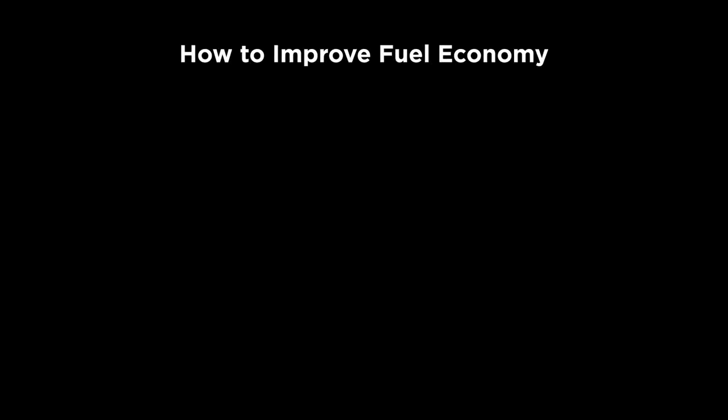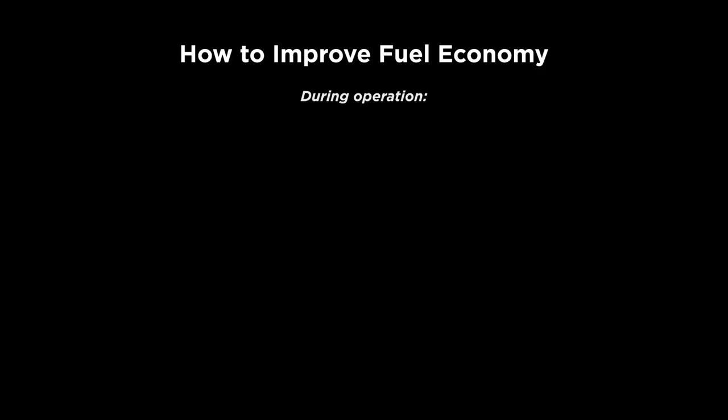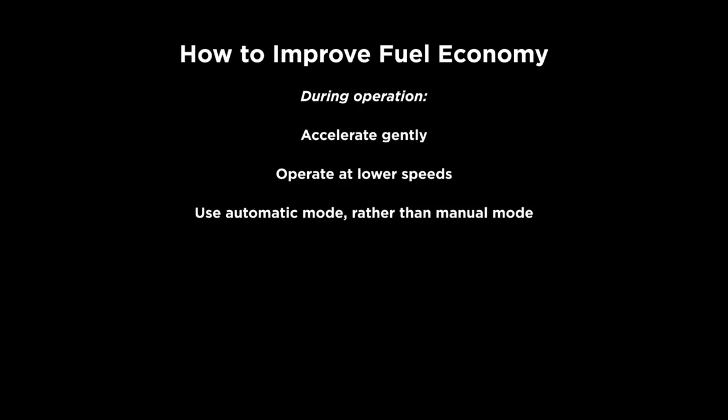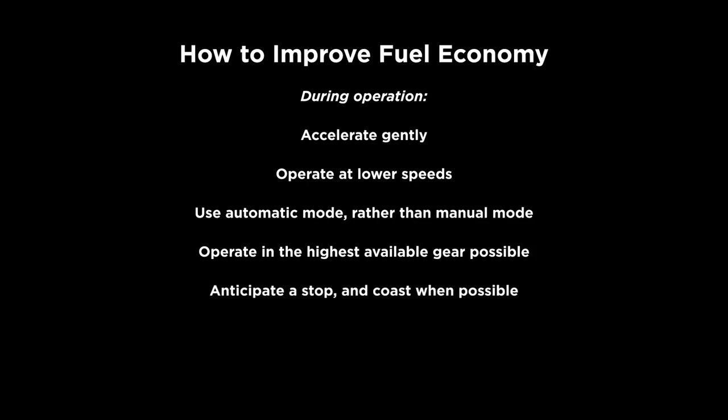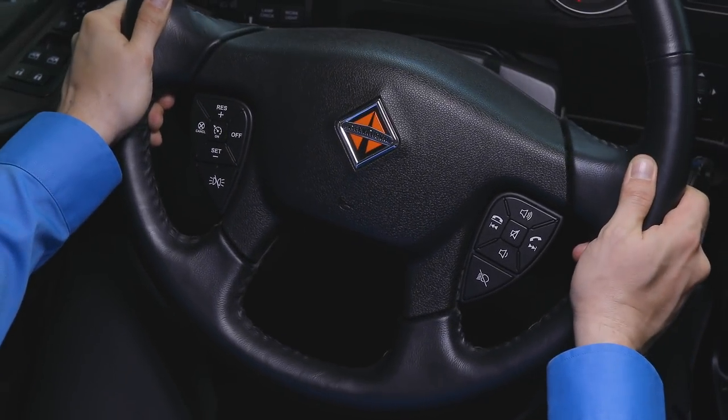You can improve fuel economy by how you operate your vehicle. When parked, minimize idle time by turning the engine off or by using optional no-idle systems such as fuel-fired heaters, battery-powered HVAC, APU, and auto start-stop system. During operation, accelerate gently, operate at lower speeds to reduce aerodynamic drag, and use automatic mode rather than manual mode if your vehicle has a stock shifter. Operate in the highest available gear possible. Anticipate a stop and coast when possible. Avoid harsh starts and stops which can be tracked by telematics. When passing, change lanes before getting close to a slower moving vehicle to avoid needing to slow and re-accelerate the vehicle when possible.